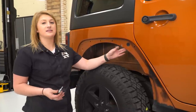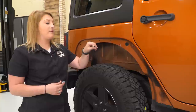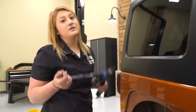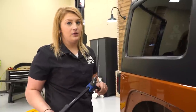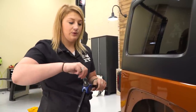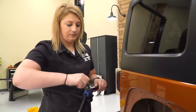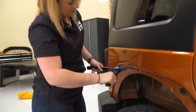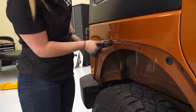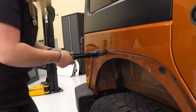Because we don't have access to the inside of our inner fender well to bolt up our tube fender, they provided us with rivnuts in order to attach it. Instead of manually doing it, you can use the rivnut tool. You just have to fully open the tool, thread the rivnut on, insert it in where you want it, and tighten it down.